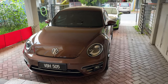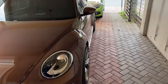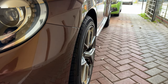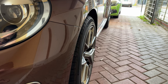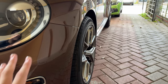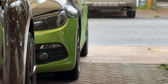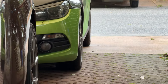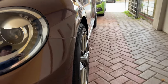Alright guys, we are back. They've installed it and I'm really happy with the result. These are ET42 rims. I was supposed to go for ET35, but after my calculations and measurements I realised the recommended ET35 that many shops suggest doesn't work out for the Beetle. Unlike the Sirocco — that's ET35, 17 inches, same PCD — these are ET42, and you can see the difference.